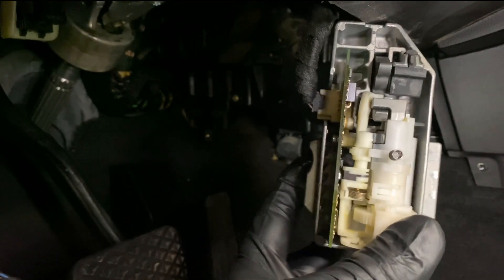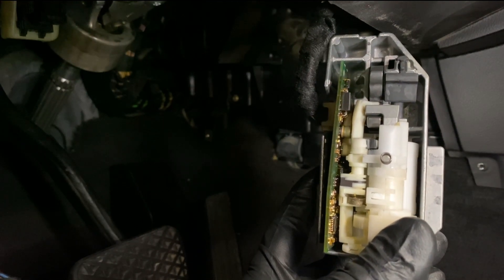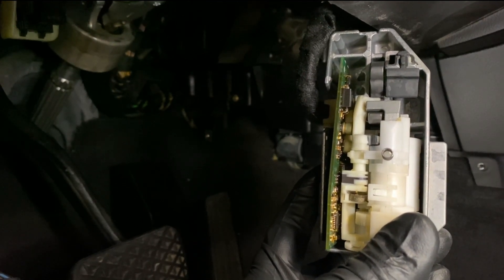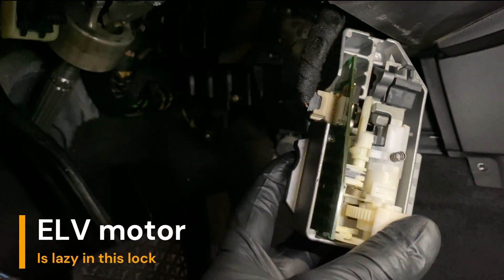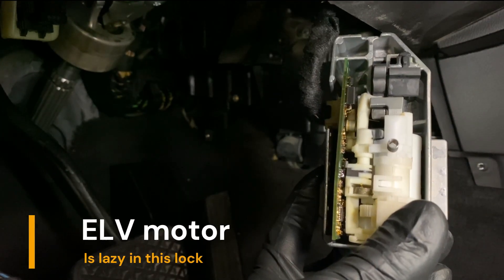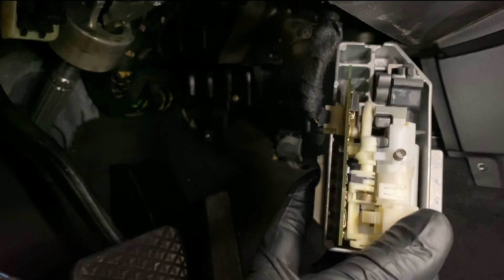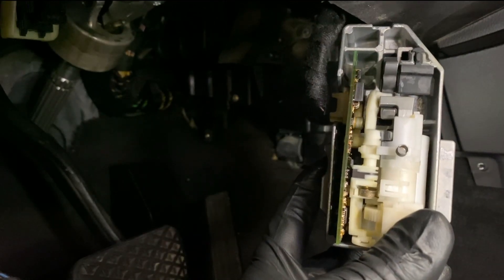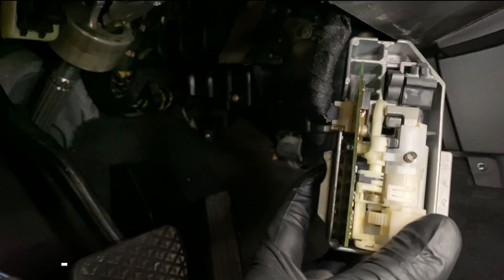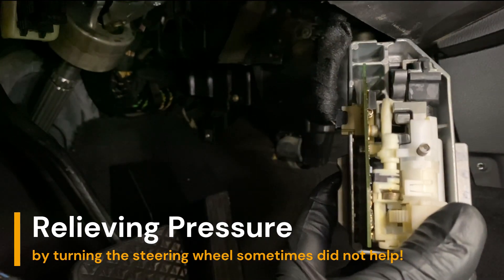Many things can cause that, but I've got quite a good battery on it and the main battery cable was replaced at the BMW dealer for free under warranty, so I can exclude most causes. The JBE doesn't have one - it has a KGM general module and it has a built-in terminal 30GF relay on that. It basically works straight from the CAS. There's not many wires - I think there's four or five wires on it.